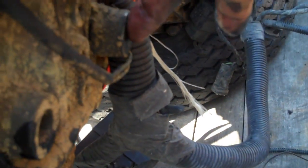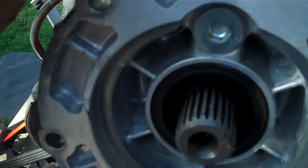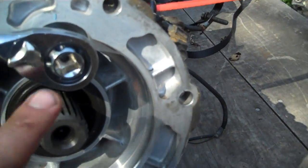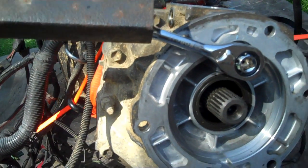Your reverse switch — you've got to take this right here out, take out your reverse switch. Then we've got to pull this plug. On the Wrangler transmission it was kind of a beast to come out, so what I ended up having to do was put an Allen head wrench in here and put a cheater bar on the end of it. Next thing we're going to do is pull this right here out. I've got a cheater bar and a ratchet — that is a 10mm Allen head going up inside there, so you basically just put the boot to it and break it loose.